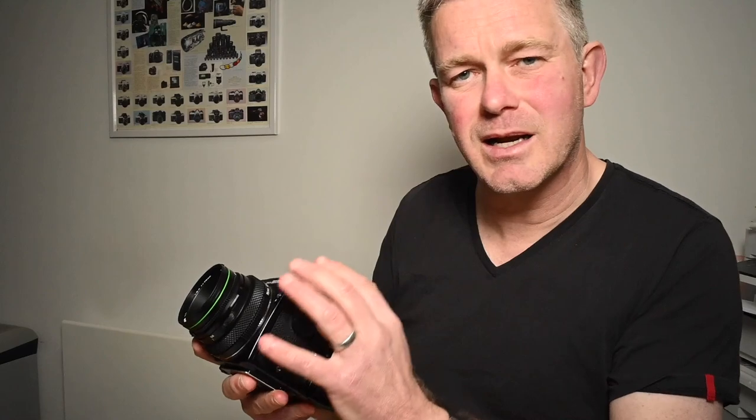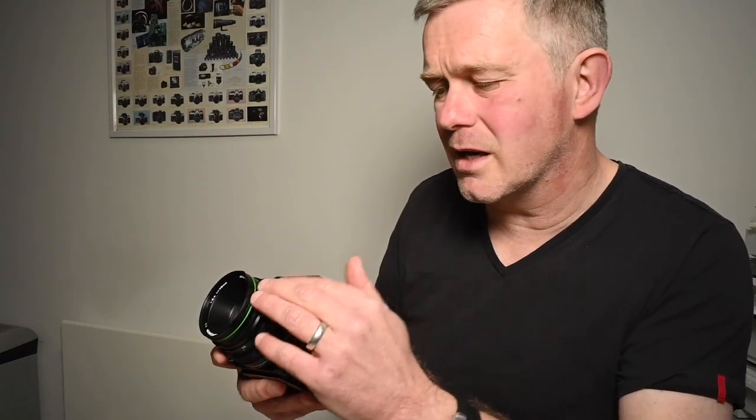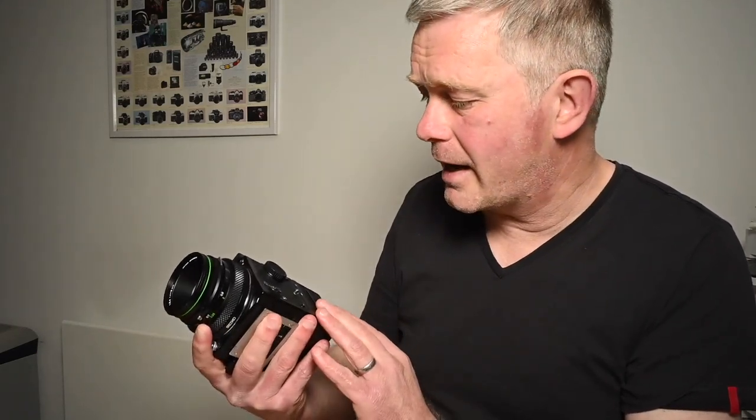So at this point you've checked the cosmetics — that it hasn't been abused or misused; you've checked it mechanically and electronically, including the shutter timing; you've checked the lens focusing and aperture; and you've checked the glass for fungus and faults. Obviously put a test film through if you can. If you've done those checks and got a clean bill of health, you can be confident you've got a good, reliable camera. Whether buying off eBay or from a dealer, try to get a return option so you can satisfy yourself it's in tip-top condition. I hope that's useful — please leave any comments below, subscribe and like, and I hope to see you again soon.